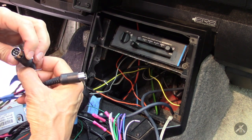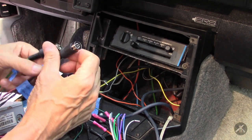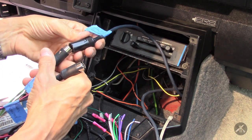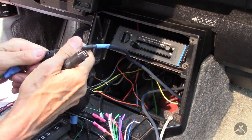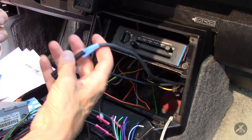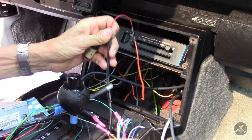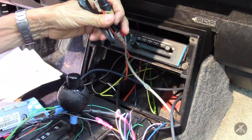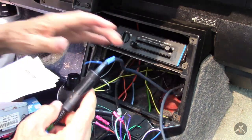Then I took the speakers — because of the rear amp — and I built cables. I bought the connectors to match the Kenwoods. So I have a front connector that goes back to the Kenwood amp, and I've got a rear connector. So there's front to front, rear and rear — and that plugs together like so. This one is the one that goes back to the Yamaha amp. That amp is going to stay unplugged from power, so I'm just going to tuck these wires away.